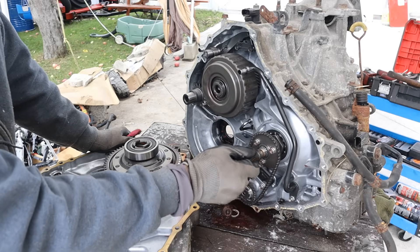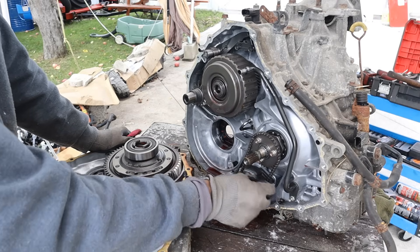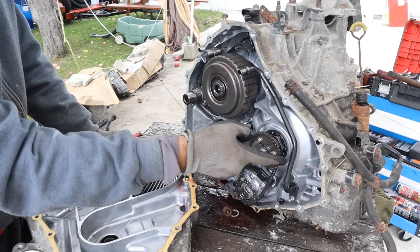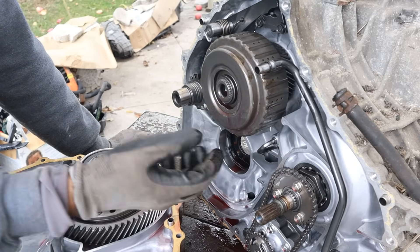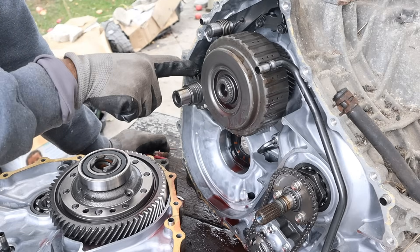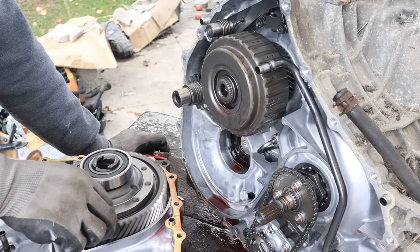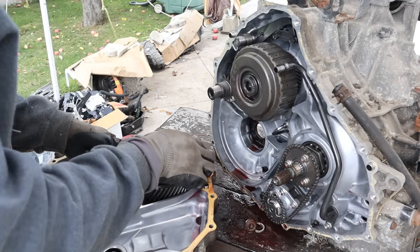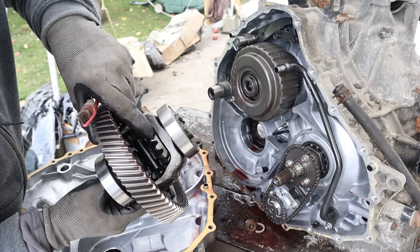Taking a look at this Honda CVT, as I rotate the input shaft you can see I first rotate the oil pump through this chain drive. That's going to provide cooling and lubrication but also oil pressure through these pipes so we can control this clutch pack. This here is likely the output from the second variator on the other side. The output of that gear is going to spin this counter gear, and then the small gear is going to spin this much larger differential, giving you a nice torque multiplication. That's where your axles plug in to turn the wheels. If you want to learn more about how differentials work, check my video linked above — this is just a very simple open differential.